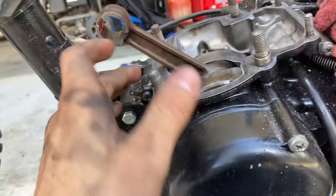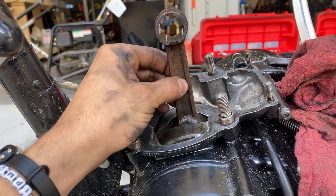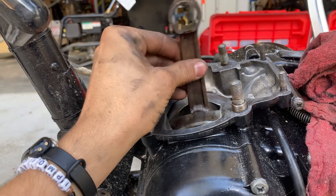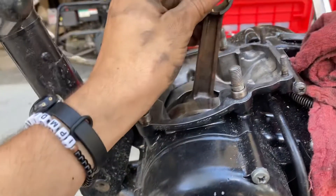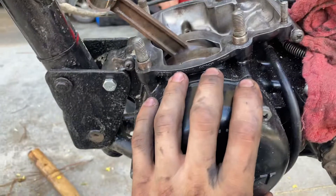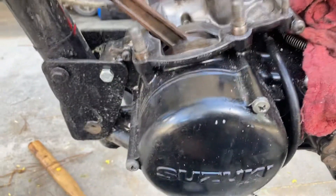The other thing I'm not very familiar with — and don't freak out, I very carefully laid this down — I know that you're not supposed to have any top and bottom play, and I really can't feel much of any at all. There's obviously side to side and I can kind of twist it just a little bit, not too much, but there is no up and down play. I'm not going to do a bottom end — I don't have $1,000 to spend on a fresh bottom end of this motor. I'm realistically just probably going to rebuild the top end and go from there.